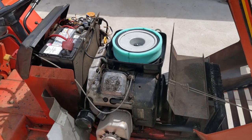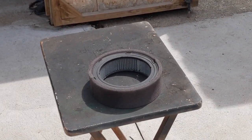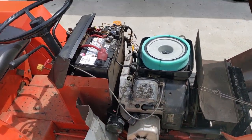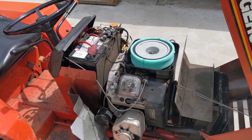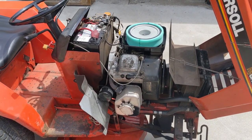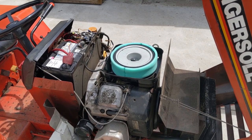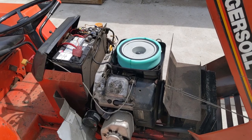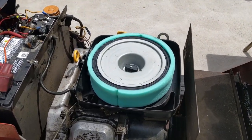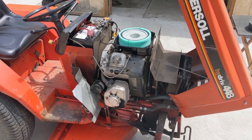You guys could hear how this engine sounded without the air filter at all — it ran perfectly fine. Then we went ahead and dropped on the Briggs & Stratton air filter that my customer had installed. Once I fixed the choke lever I figured the engine would run just fine, and I never suspected that a Briggs & Stratton air filter could cause this engine to run rough. In all my years of doing small engine work full time — about a decade — this has only happened to me twice, and that was a brand new Briggs & Stratton air filter. By removing it the engine ran fine. We installed the less restrictive Stens air filter in its place and the evidence is clear — this engine runs as it should.